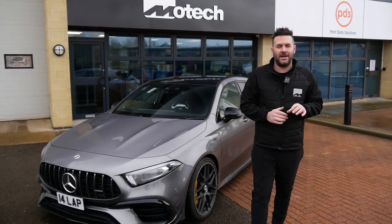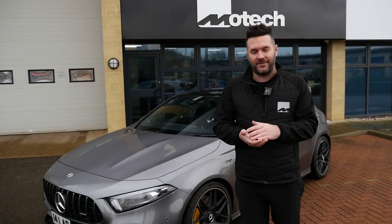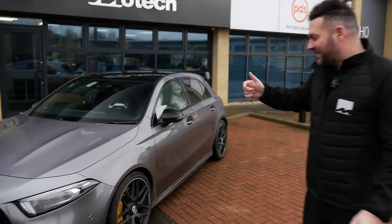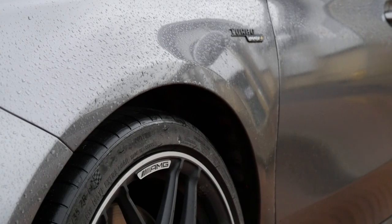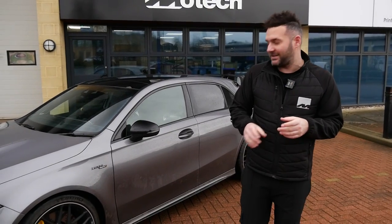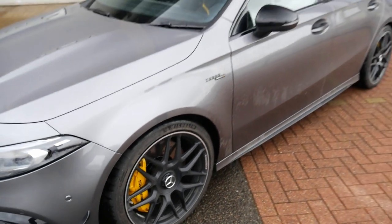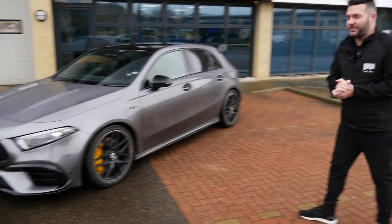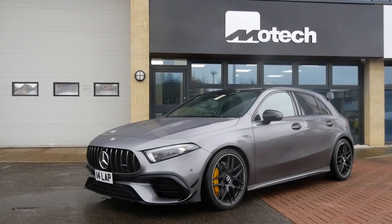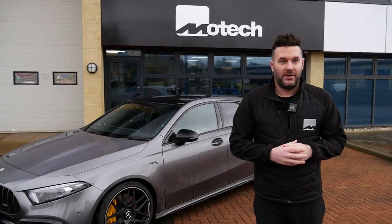Post road test summary: 12mm spacers all the way around, new extended bolts and new black lockers fitted. The black spacers match the painted black hubs perfectly. With most modern wheels being black, the spacers actually make the wheel look deeper and give it more aggression, while also pulling it away from the caliper. Mike notes they've done around 10 to 12 of these setups on A35s and A45s — there just aren't many of them around, though Motec does a lot of Mercedes work alongside their BMWs.